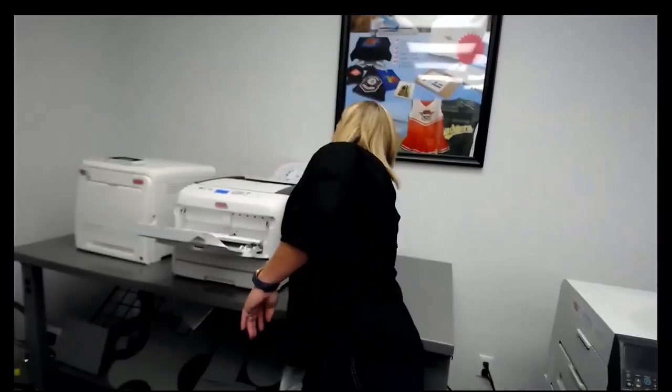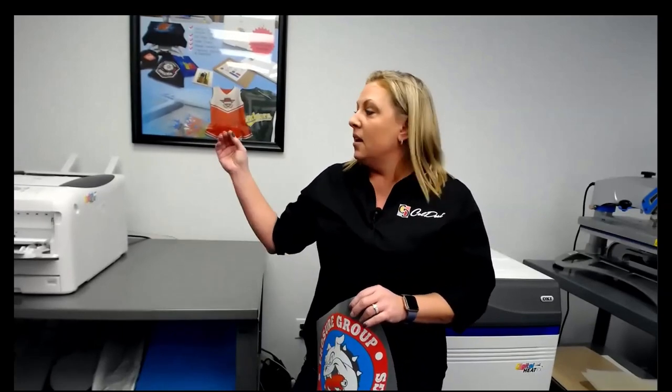So for each printer — I'll talk mainly about our flagship since there are different specs for each. Probably between year two and four of the life of your printer, you have one fuser, and each color — which is four CYMW — has a drum. Each part is around $250. Your fuser will give you about two years of life. Your white drum is going to give you about 10,000 prints and each of your color drums is 30,000. Other than replacing my toner and paper, that is all the maintenance I need. So just from a planning perspective: 10,000 prints you replace the white drum, and our average customer makes about $8 to $15 per shirt — so 10 bucks average. You would have made $100,000 in shirts. So $1,250 over the course of two to four years — not so bad.